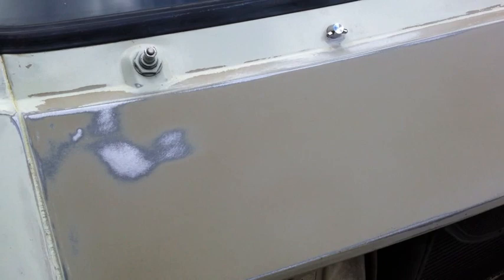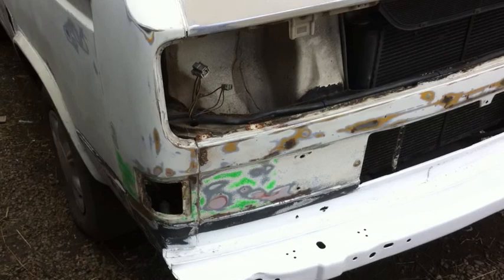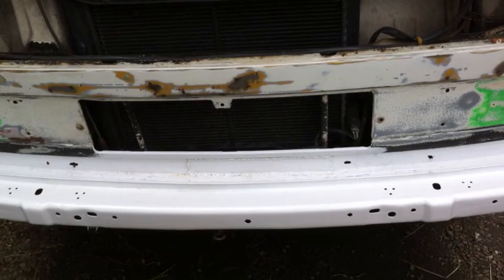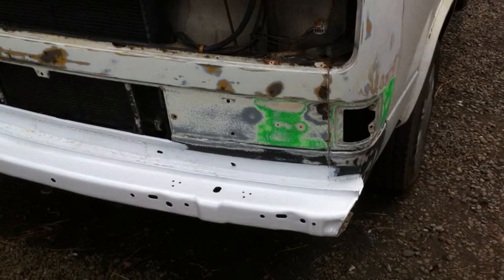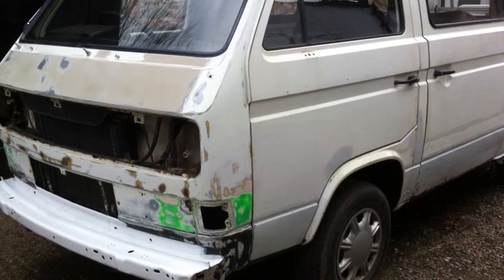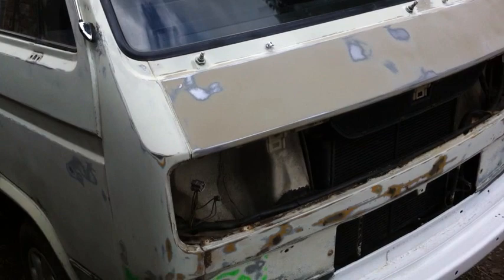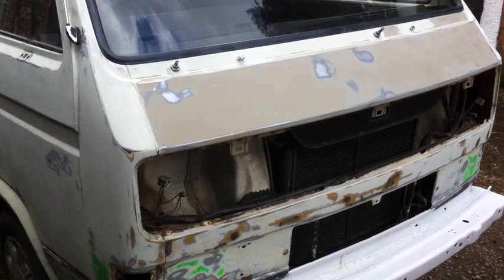The way I'm going to work this: the first coat of paint - and you have to bear in mind that Rustoleum is a self-priming paint, so you don't need a primer. It also has a rust inhibitor, so any surface rust will be neutralised. You can see the difference here on this bit compared to the door where I've done it. I'm going to put on the first coat as a basic sort of primer coat. I've just done this door as well.